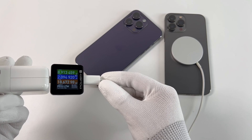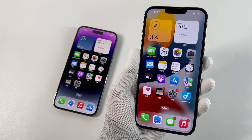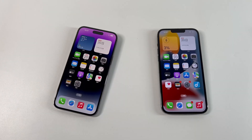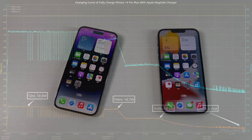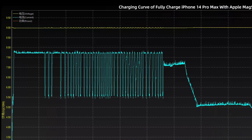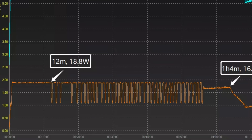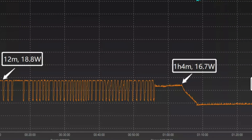Next, let's look at the performance of the whole charging process. Both iPhones use the same charging combination as before and were placed in a 25 degree Celsius thermal tank throughout the test. Here is the test result of the iPhone 14 Pro Max: it can trigger 9V throughout the test. The power is stable in the first 12 minutes with 2A current. After that, the current fluctuates and the power changes rapidly between 11 to 19W until 56 minutes.